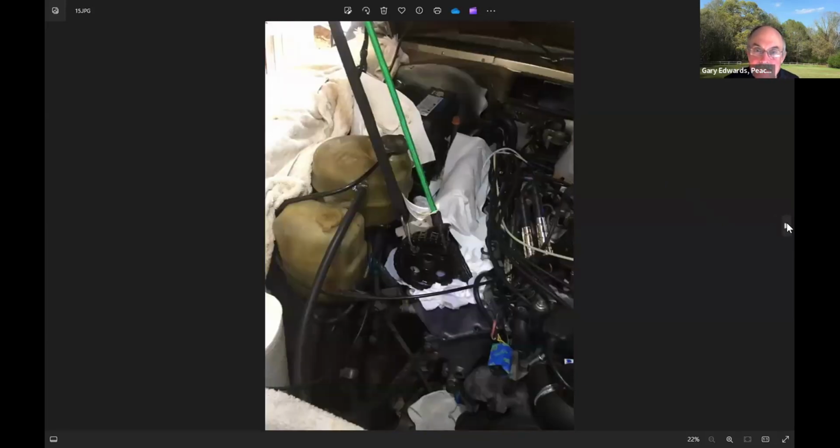Okay. And then here's finally putting the sprocket back on. I bought new sprockets. The sprockets wear, and instead of kind of U-shaped valleys and kind of rounded teeth, they end up being much sharper teeth. And that tells you it's kind of an older, more worn sprocket, and that can cause a slacker chain. And they're not even that expensive.